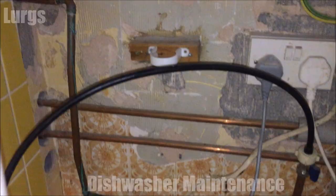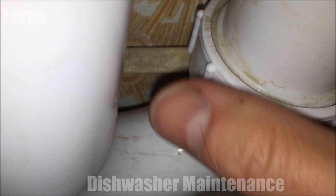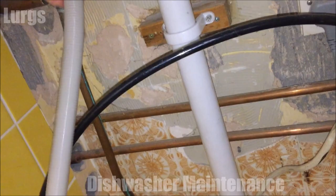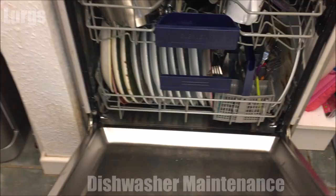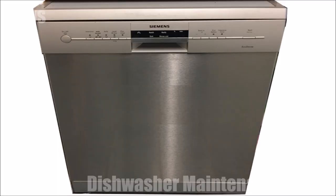That's all looking good, so it can go back on. Just some general dishwasher maintenance to make sure it's all working smoothly and in tip-top condition. Hand-tighten only — do not use pliers on plastic threads. Remember to put the wastewater pipe back in; if you forget, the next time you run your dishwasher you'll have a flooded kitchen. Check the cold water inlet visually, put the top and bottom trays back in, and that is the dishwasher maintenance video. Hopefully that's helped somebody out there — thanks for watching, cheers!